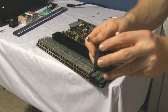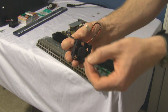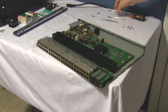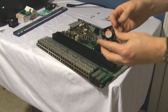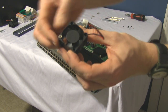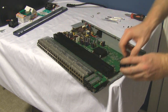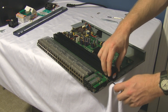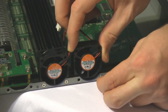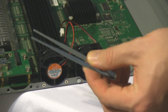Here on the 40x40 stock fan I'm about to pop out two collar receiving ends from the bolts. We'll reuse those in the other ones, but the 40x10 fans don't have these, so that's why we'll use the machine screws. As you can see here it has a collar receiving end and we'll reuse that. Get the power oriented on the right side, put three of the same ones in. Drop those collars back in the bottoms — you might have to push it in kind of hard or have the screw pull it in to let it set into the plastic. You'll need a pair of tweezers for this; it's kind of tricky. A good pair of PC toolkit tweezers is what I use here.